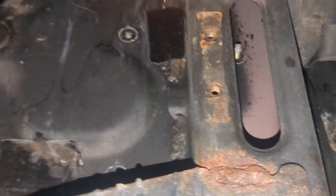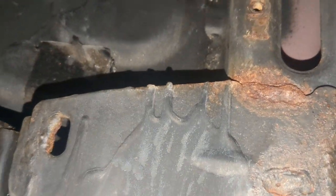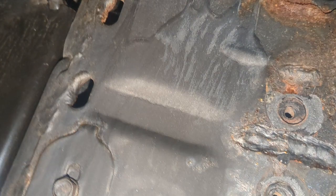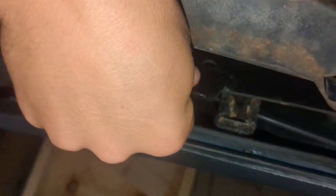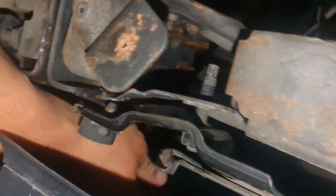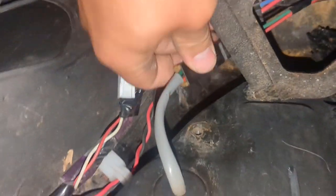And then there's four spots that hold the tracks that the window rides on. Sorry, three spots that the tracks are held in by, and four spots that the motor that runs the thing is held by. Already got the screws off, the nuts off here. But I think coming up, I'll show you the other way around. Disconnect this wiring harness and pull it through. That's for the window motor.